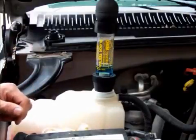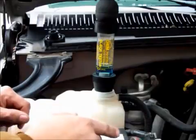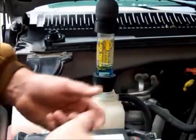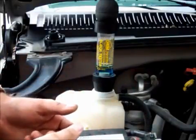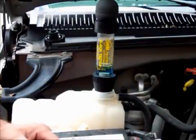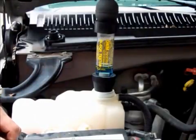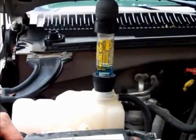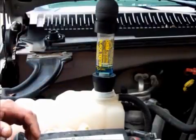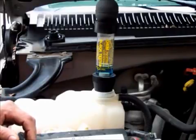The thing is, with a V8 motor, what I would do is pick one side of the motor and pull all the spark plug wires off, disabling the spark on that side of the motor. Then start the vehicle up. You might have to let it run for five to ten minutes. You may need to keep the RPMs up a little to keep it running, because a lot of motors will be really hard to keep running that way.